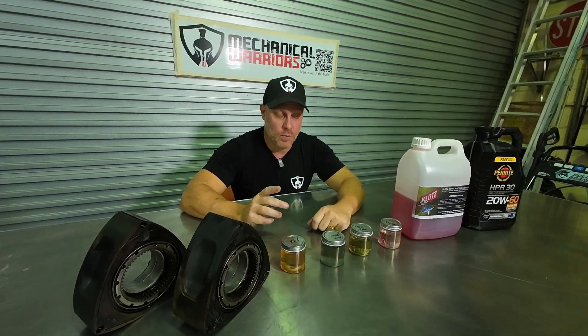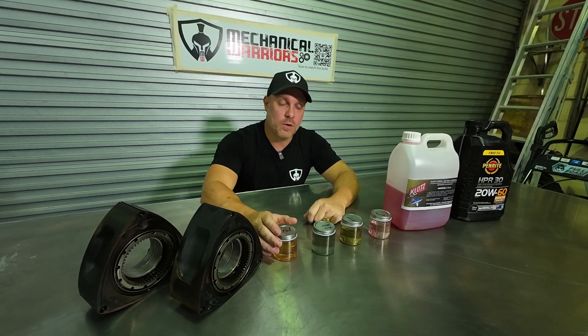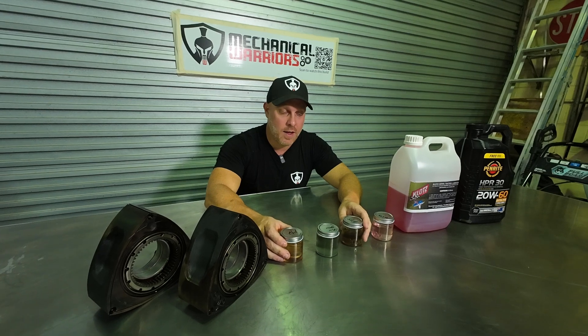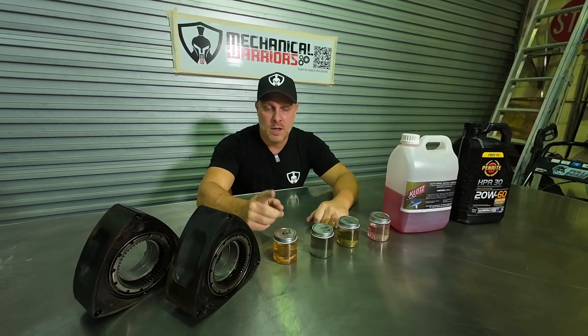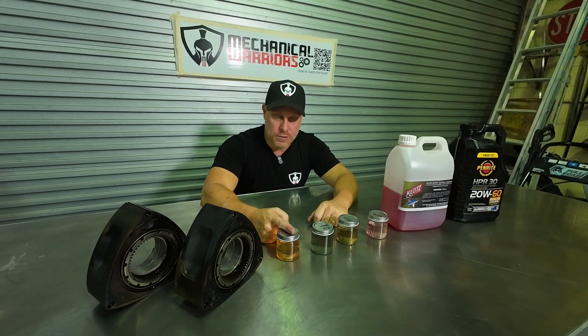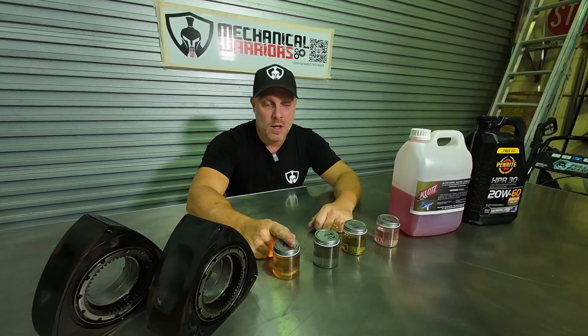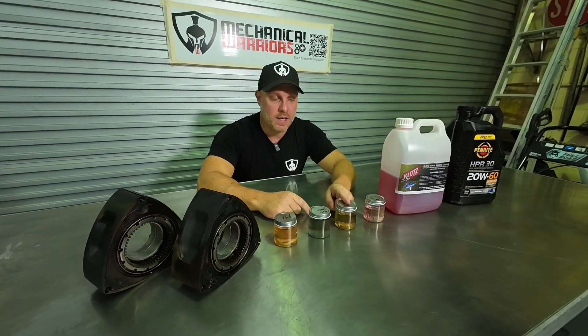I have a solution to that problem which we're going to do on the RX-8 — create two fuel systems. We'll have 98 and E85 in separate tanks tied together so that 98 sprays anything under around 14 pounds of boost, but if we exceed that boost level it will switch to E85 automatically.